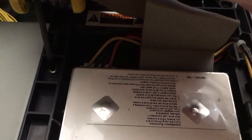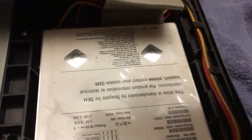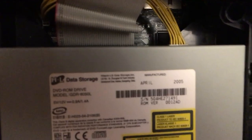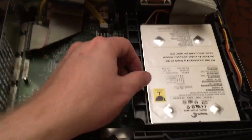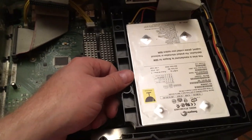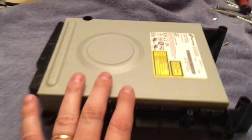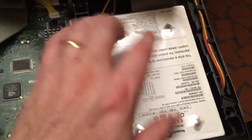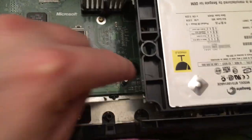It's a T10, so you need a Torx T10 and a T20. Anyway, I'm going to take this drive out. You'll also need to unplug the power cable and the IDE cable. One thing to note is that you'll have to take this hard drive out first before you take the disk drive out. But once you get that screw out you're good to go — use the screw here, here, and here. That's three screws, though it may not be the same for all models.